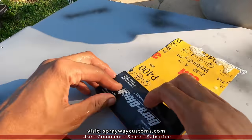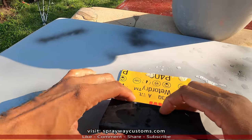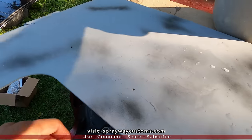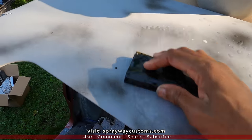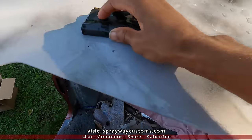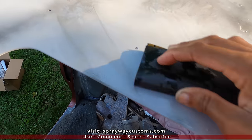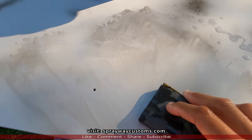Now I wrap it around my block. I have three sides to work with. I'm gonna start on this side. What I'm gonna be doing is removing the guide coat. Once all the guide coat is removed, you know it's flat. What kind of pattern is that going in? X pattern.